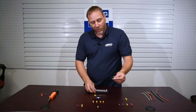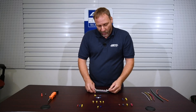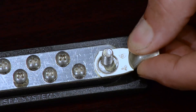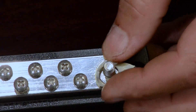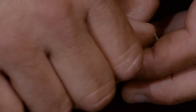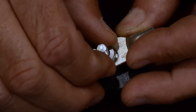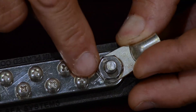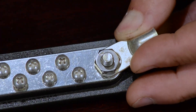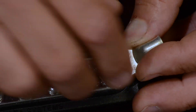The same issue applies with a large battery terminal. If I use a lug meant for a larger wire, you can see it's not going to sit well, and even when I put the nut on, there's a lot of spacing and the nut is bearing on a very small area of the terminal — again creating an area of resistance and voltage drop.